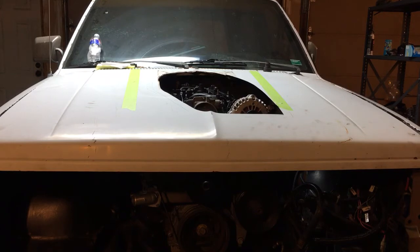Here's where I'm at. I decided I'm going to cut an access hole in the hood so that it'll specifically clear the LS engine with the truck intake and the truck accessory location. I had just eyeballed it with a straight edge across the fenders, and I was like, okay, I'm going to need a minimum of a three inch cowl hood, maybe four inch just to be safe.